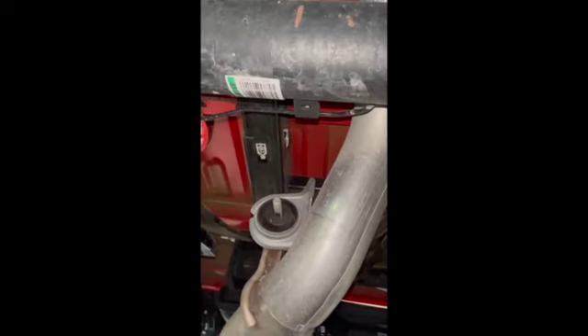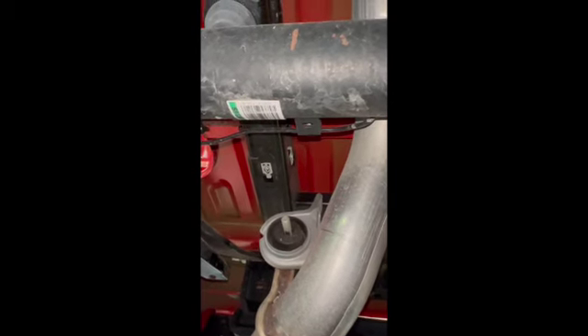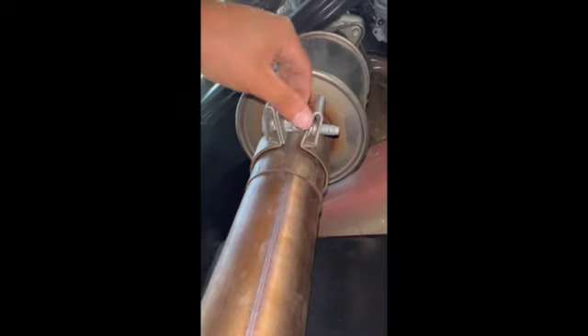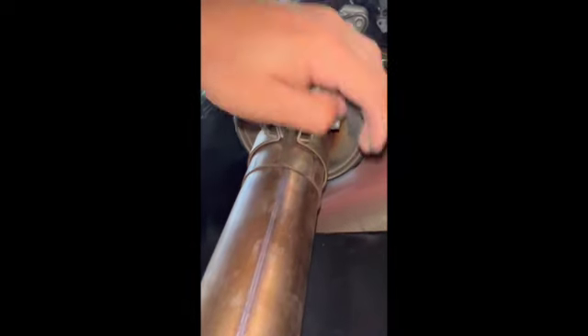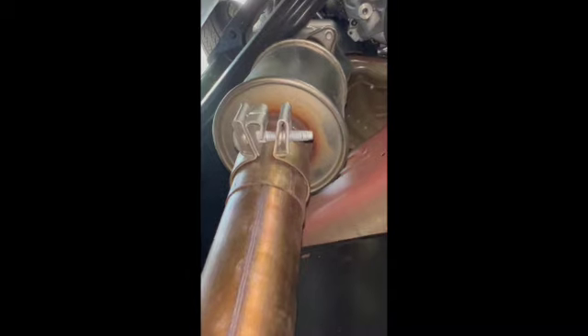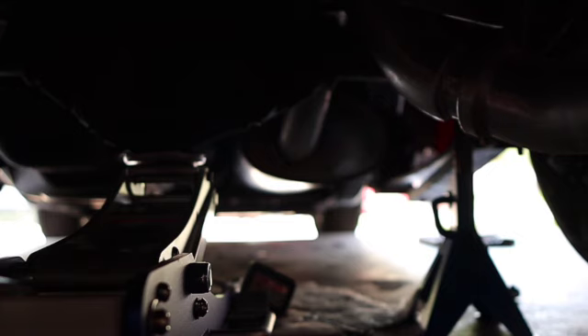The bolt on the bottom is vertical and the bolt on the side going into the frame is horizontal. You've got the third hanger there, the second one by the drive shaft, and the first one here. I removed the bolts and took the nut off this bolt. The clamp is loose — it has a little stop right here, you can see where the grooves are. I need to go in the back and twist it to knock this whole thing loose so I can fish it out.